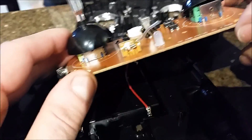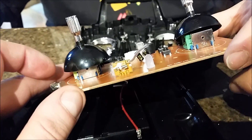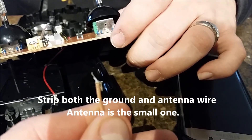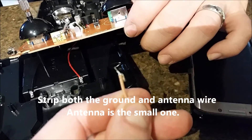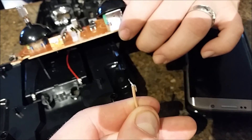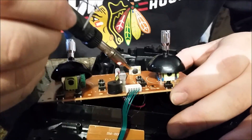The problem with the X5 SW is there's no ground finger, no grounding plate on the antenna — there's just the antenna wire. So we're just not gonna connect the ground at all. You can see the ground wire there — we've got to pull that to the side. We're just gonna connect the signal wire and see what happens.